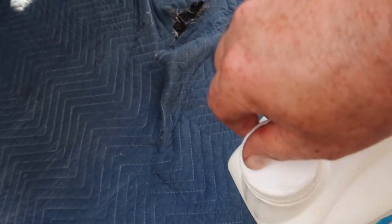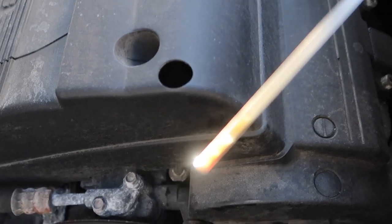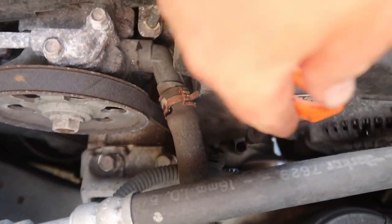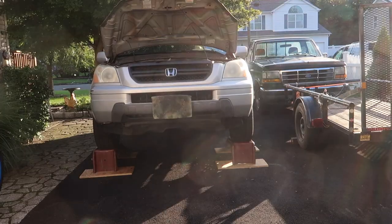When you're done, check your oil to make sure it's full. It should be between the two dots on the dipstick — kind of hard to see right now, but she's good. Put the dipstick back. Now do a little cleanup, get her off the ramp, and that's it. It doesn't take too much to change your oil as long as you have the right tools. When you're done cleaning up, check for leaks — see if you see anything under there. Looks good to me, another job well done.